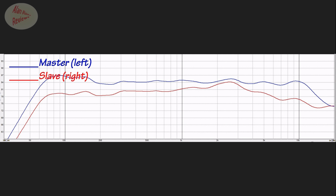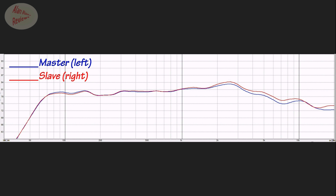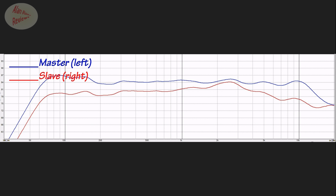If you look closely at the bass up settings — here we have bass up in stereo, left and right speakers — now look at the right channel: it's the bass up mode. So actually, setting custom in the app, the left speaker picks up custom, but the right speaker is picking up bass up. The question was: is it something to do with the way I'm setting the speakers? Both speakers have different custom settings, just so I could see exactly what happened and make sure the slave picked up the exact settings from the master — which it isn't doing. It's not picking up the slave's custom settings either; it's picking up the bass up settings.